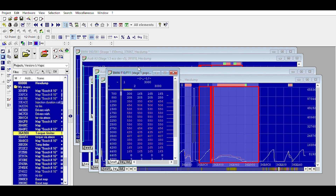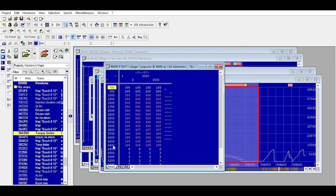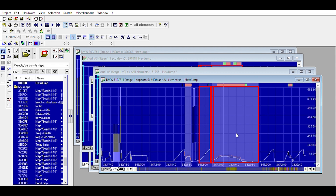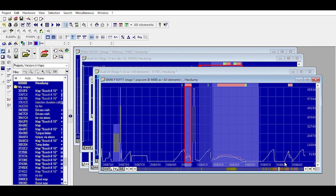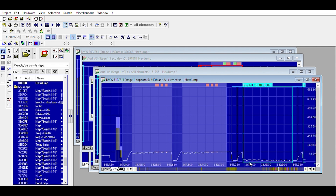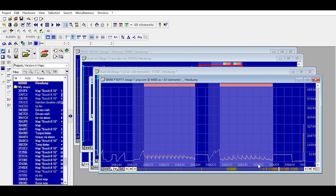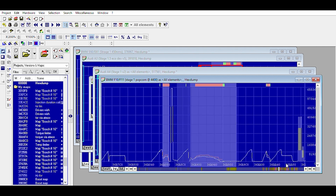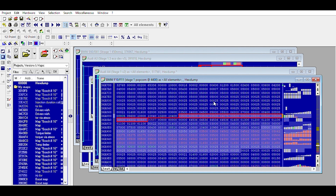This is very different to what you're probably used to looking at. The way they do it is different-looking — it's a much bigger map, a 4x23. Here's kind of what you'd see. I'll find the map source document — this is an EDC17 file. It's just these high blips; that high blip is your RPM — 11,000 — then it drops to zero, and then it has all your torque values. WinOLS won't always detect this automatically.